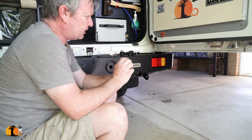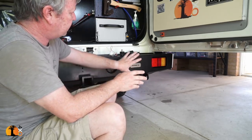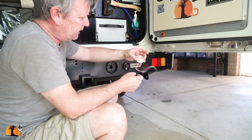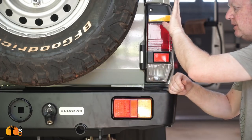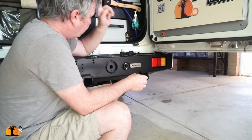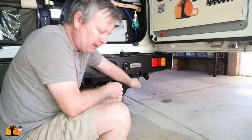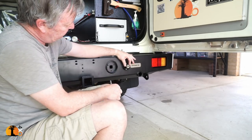I tend to change a lot of things. The Gobi X rear bumper is supplied with a reversing lamp that fits in there and looks quite good. The one problem is that the light they supplied is about as bright as a glow worm in a jar. The new position of the wheel will obscure the reversing lights on both sides. So what I've done is use that recessed mount — which was made for the light — to mount my air outlet, which originally was under the old bumper. Now it'll be even easier to get to and partially protected by that recessed mount.